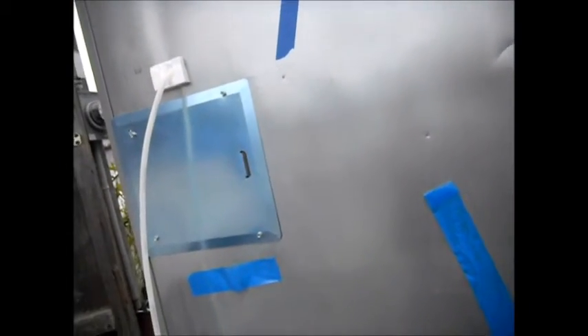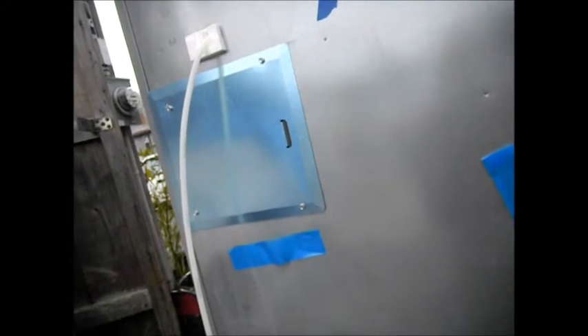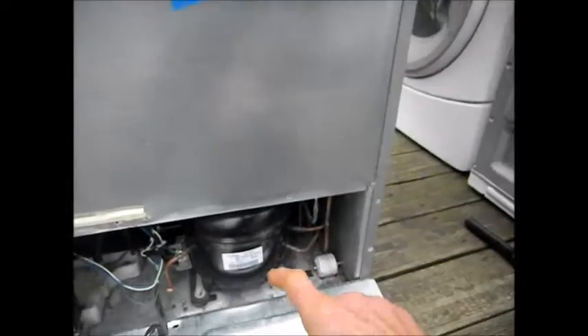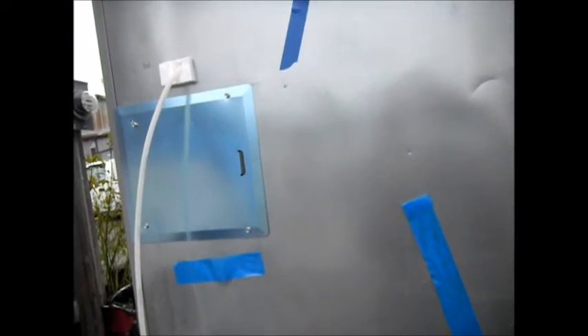That board was rebuilt with the capacitor kit. The capacitor kit seemed to bring the display up, but the compressor is not coming on. So I think it's going to be a relay in that control board — the brain.